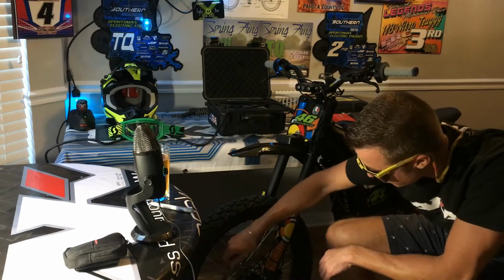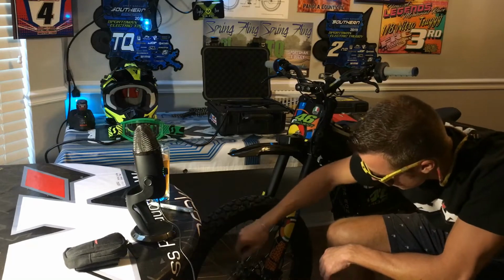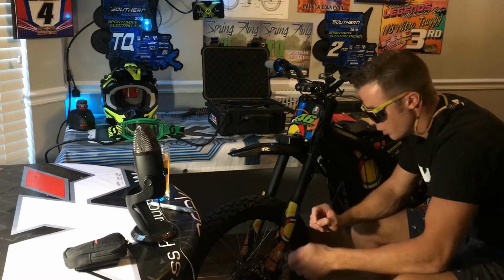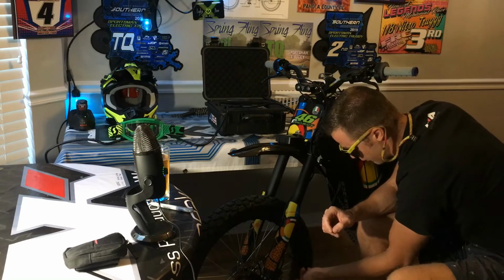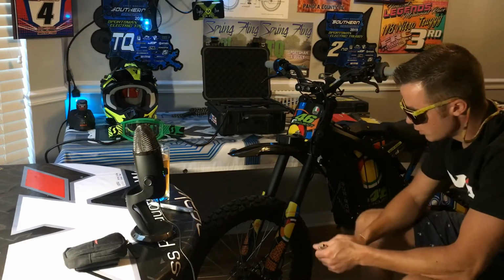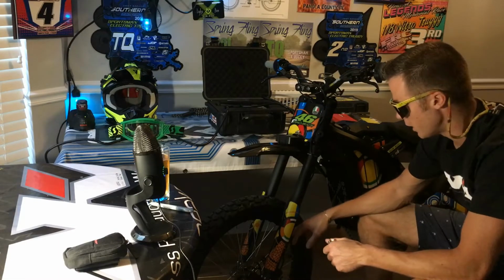And then you go over them, and you listen to them, and they should all have a nice ring to them. If they're loose, they're really gonna have a thud to them, okay? You don't want them to have a thud to them. So keep these spokes tight. You won't get any bent spokes.